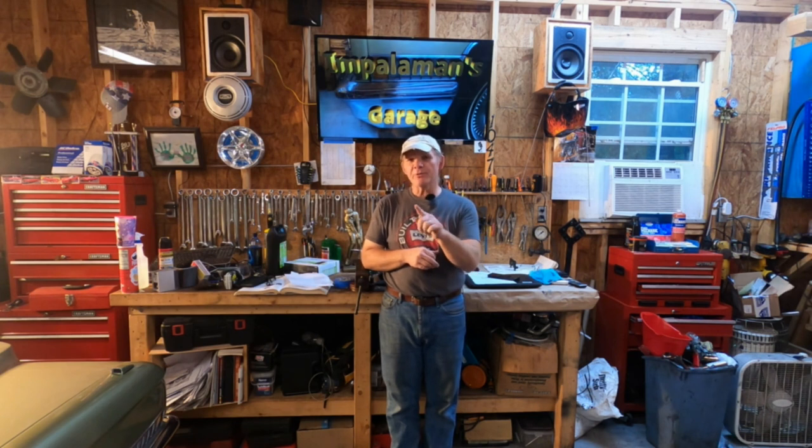You put too much initial timing into one of these Cadillac big blocks, and that distributor rotor is going to skip. It's going to skip one of those contacts in that distributor once in a while. You've just got too much timing in there. So that concept, added to the original slightly jittery idle, just complicated my issue twofold.